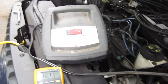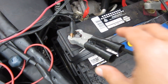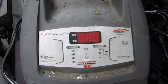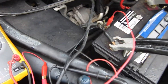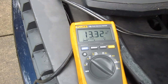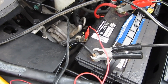I started charging up the battery, ran a long extension cord out here, and the thing was stuck at about 37%. I disconnected the battery terminal because I suspected that maybe something was drawing current and not allowing it to charge up. When I did that, the charger went up to about 68%. I figured I'd check the voltage — if it's not drawing any current, there shouldn't be a voltage from this disconnected battery terminal to the battery. It looks like it is about 13 volts across there, so that doesn't sound good. It sounds like something's draining the battery that we don't want.